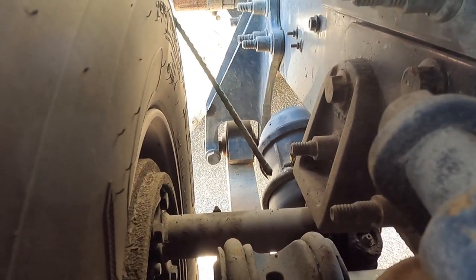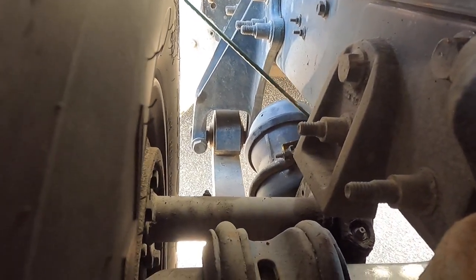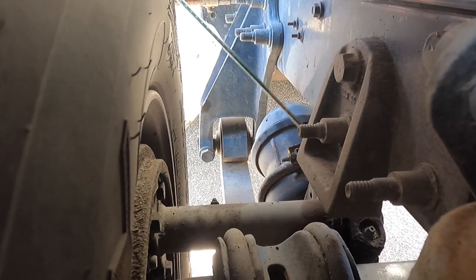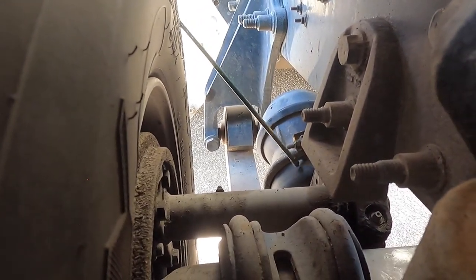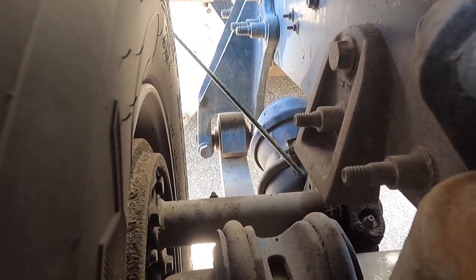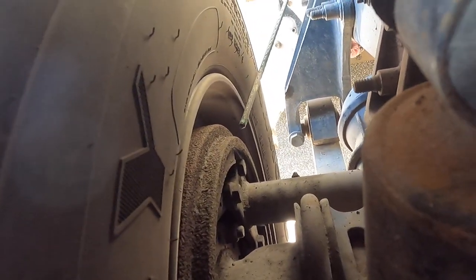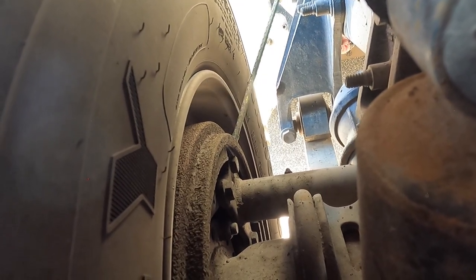Okay, my brake system. I have my brake hose, which is not leaking and mounted securely. My brake chamber is not leaking, and the clamp and the bolts are on tight. And the slack adjuster and push rod are not bent or broken and have no more than 1 inch of play when the brakes are released. My drums and linings are not bent, no illegal welds, no oil or grease on them, and they're not worn